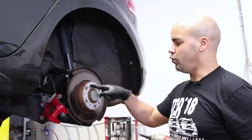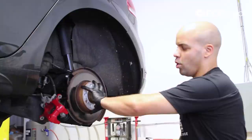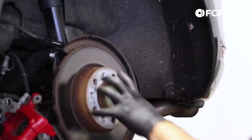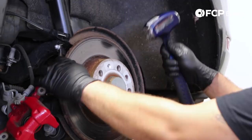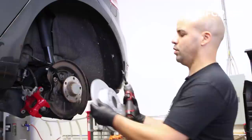You're going to need a T30 Torx bit to remove the brake rotor set screw. These should not be too tight as they just hold the rotor surface onto the hub. From here, you're going to want to free the brake rotor from the hub. As you can see, our brake rotor definitely needed to be replaced — it's in terrible shape. There's rusting along the edges, running rust along the hub hat, and typically that rust will build up along the surface of the hub and make it stick. So we're going to use a hammer to persuade it off. You don't want to go too crazy with how hard you hit it because you do not want to damage the hub. You can see all that corrosion coming off — freeze it off and remove it.